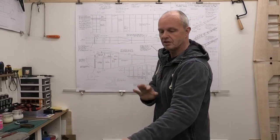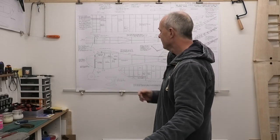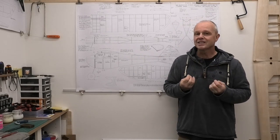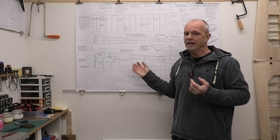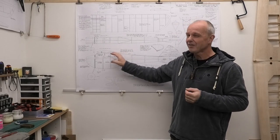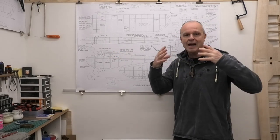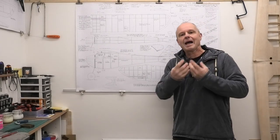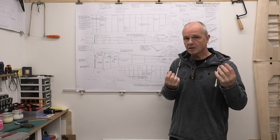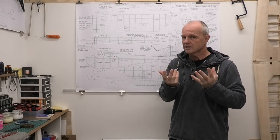I'm not going to use the integral tank that came with the Bantam 19, so I'm going to be including a separate fuel tank. I've also got the spark ignition system and the radio gear. I'm going to need to think very carefully, not only about how I get everything in, but how I get a little bit of separation between the ignition equipment and the radio equipment so there's no interference.